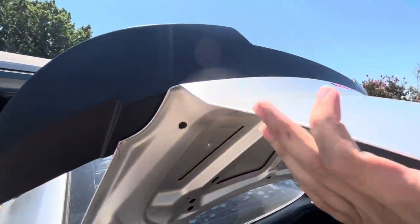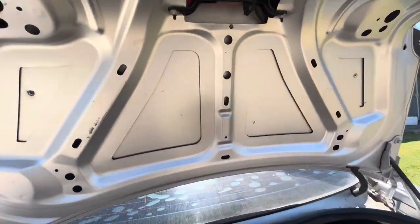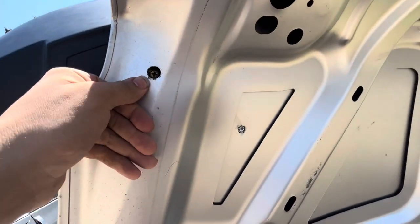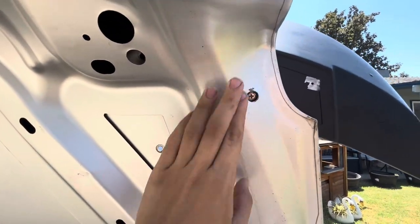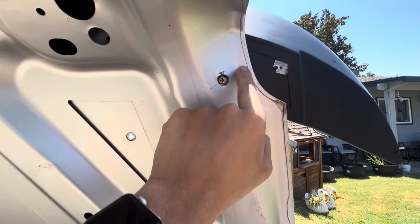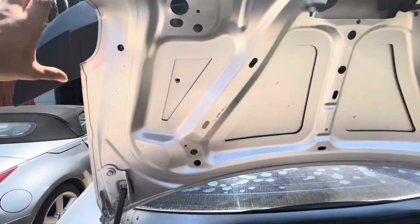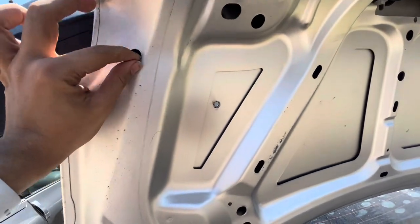The way that I was able to mount it so flush with the trunk — what I did is I took some old pieces of cardboard, like a paper bag from the store. You cut like two-inch wide by eight-inch long strips, and then you line them up with this hole. You tape it onto here, lightly tape it onto your duckbill.